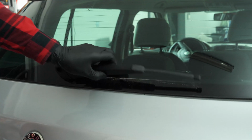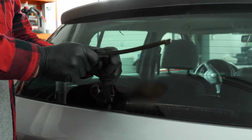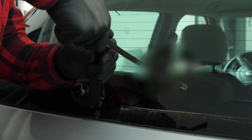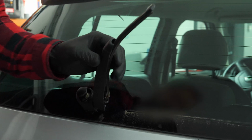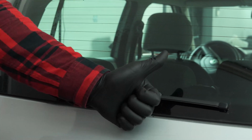Lift up the arm of the windshield wiper. Incline the blade to 90 degrees. To remove the blade, pull towards you in order to free it from its holding bar, then remove the blade. To put the new ones in place, clip them into the housing. You will hear a click when the stud slots into place. Place the arm gently back onto the windscreen. Operation completed.